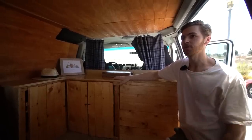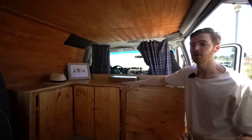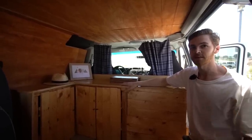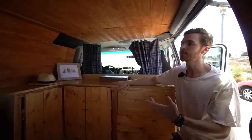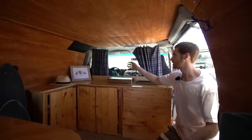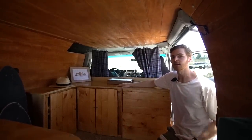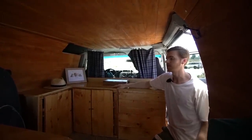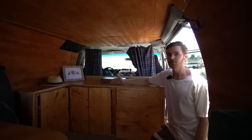With my ceilings and walls, I just went with typical paneling. These are eight-foot by four-foot panels — they run $25 a pop. I used five total and had extra leftover, so that's an easy $125 to get the whole van done. I went with this route because of the price; it was simply an easy choice for me. They do come unstained, so you want to pick a color that matches your build — complement your colors, seats, curtains, and cabinetry. For insulation, underneath I have denim insulation. Another reason I chose that: it was easy. You didn't need gloves for any kind of fiberglass, and it ran at a pretty cheap price. I did my whole van with one roll of denim insulation, which ran about $40 to $50.